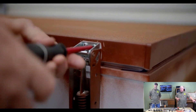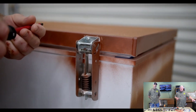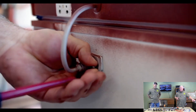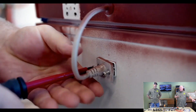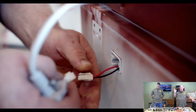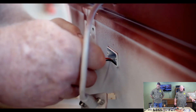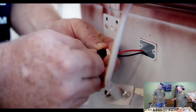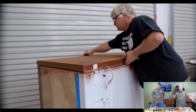The hinges come off first. There's a big spring there but it's not going to jump out at you — that's its resting position, so you don't have to worry about that. I removed the electrical, which could be slightly different in your freezer, but this one had an electrical line going into the lid to supply the light. There's a switch but it's automatic — it senses when the lid is down and turns off, and when the lid is up it turns on. We'll show you how we rewired this later because it wouldn't be functional with the controller, since a freezer controller turns the compressor on and off by turning the electricity on and off.